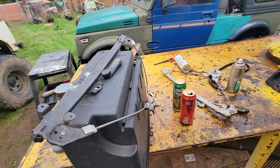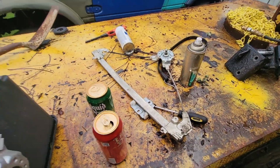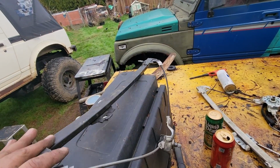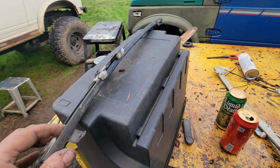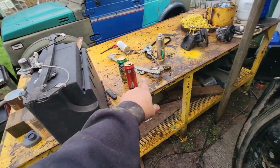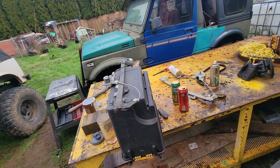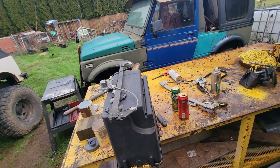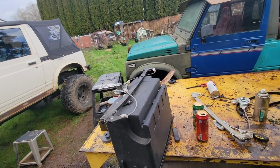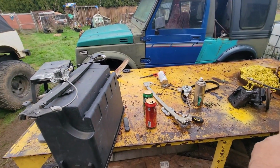Before you put the new one in, get your roller downer, roll the window down to about the same as you had the old one. That way you can put the glass back in there. And if you have any dry lube or anything like that, it doesn't hurt to try to lube this up a little bit. Honestly, I don't even guarantee this one's going to be better than that one. It came out of a rig where the passenger side was good, but I've had so many rigs here and stuff that goes in and out all the time. Somebody bought the door, didn't need the guts, so I ripped them out real quick. So hopefully I put that in there and it works better than that one did.